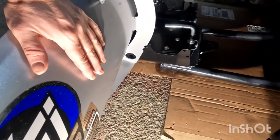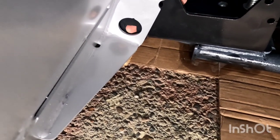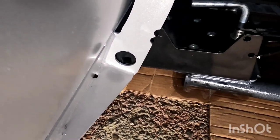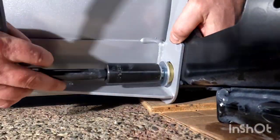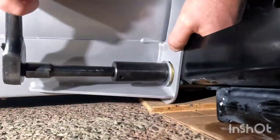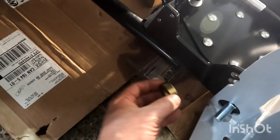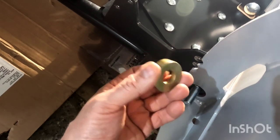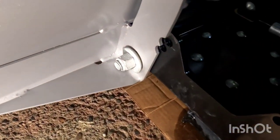The next thing you're going to do is push your plow blade up to your push tubes. You can see this hole right here — we're going to put a bolt through here, and there's going to be a spacer that goes here, a washer, and then a nut. I just want to mention this spacer: you can see how it goes in on one side. When you put this in, it's going to have that groove going on the inside and not the flat surface, so it gives it room to fit over the side of the bolt. So they're both mounted.